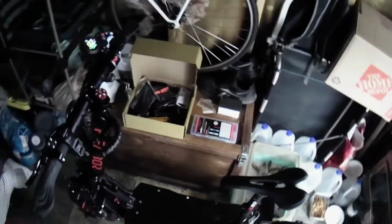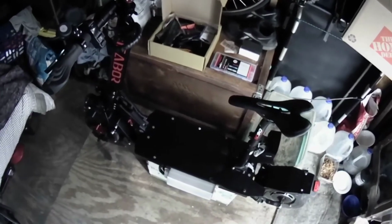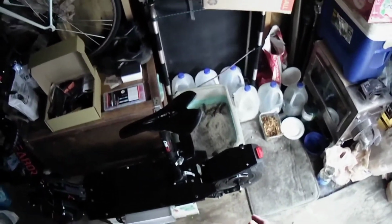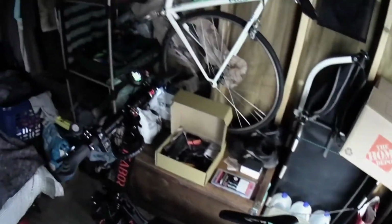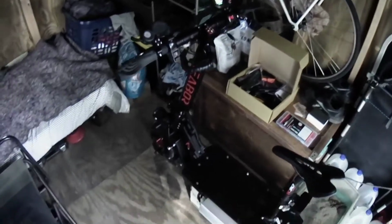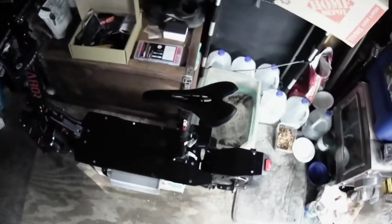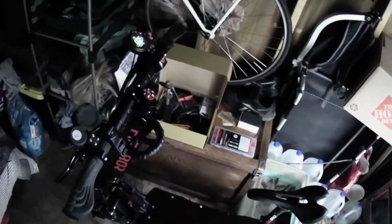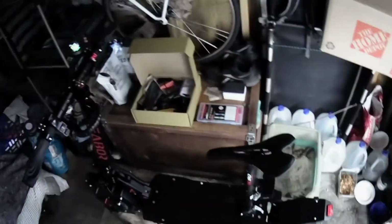So yep, this is a temporary setup, like I said, just to get me going for more power. Now my scooter has a lot more power. It's got 100 amp theoretically. Rear motor is putting out 65 amp from the controller. Front motor is 35 amp from the baby controller. Rear wheel drive biased. Sports scooter. And the wiring had to be done in such a way to get it arranged this way. It was a little tricky.